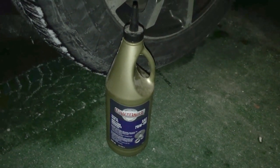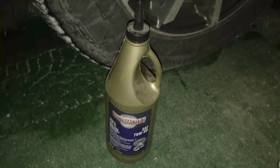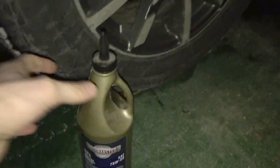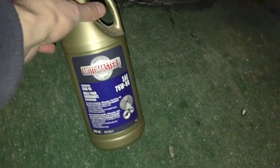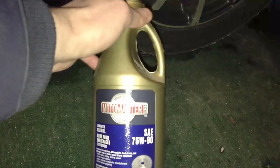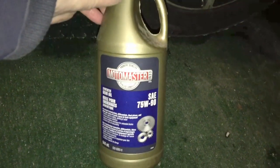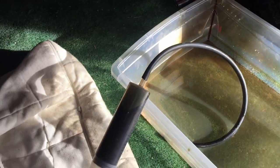Here are some tips for this oil change: if you're going to be changing this in winter or when it's cold outside, do it right after you drive the car. It's good to drive it on the highway, then park it and do the change right away — the oil will be warmer and flow out better. For the new oil, if it's cold outside, bring it inside your house to warm up, or even better, put it in hot water — it will flow much better through the syringe. When it's very cold, the oil gets very dense, like syrup, and is very hard to push. Better do it in summer or warm everything up before you start.